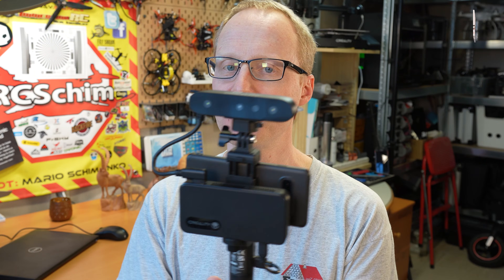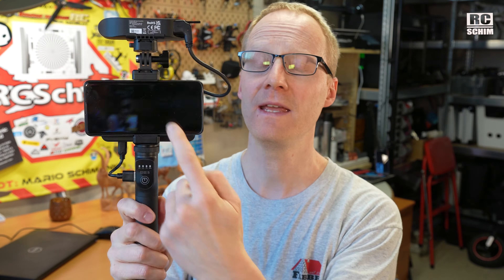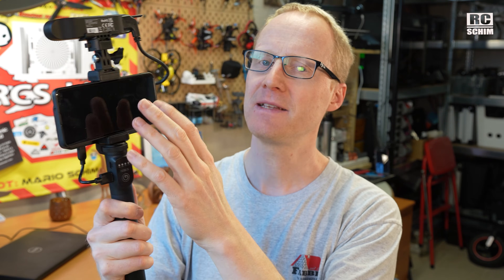Why do we need a Wi-Fi bridge? Why not connect the scanner via USB-C cable to the phone and leave this complicated technical part away? The answer is compatibility. In theory it works with my Galaxy S10 that I have here — it's an older phone. It doesn't work reliably because the USB connection is rather slow on my phone, not the scanner. On iOS devices, you can't put something into the lightning port. It's in a Wi-Fi 6 configuration because it has to transfer a lot of data.